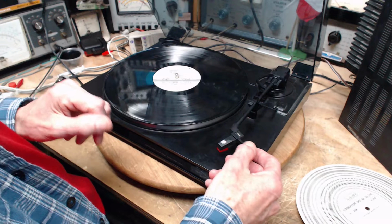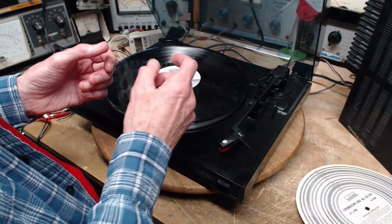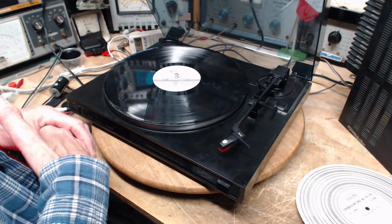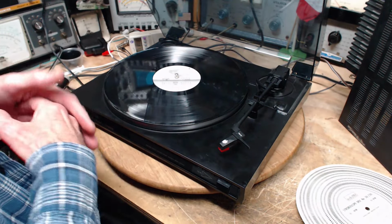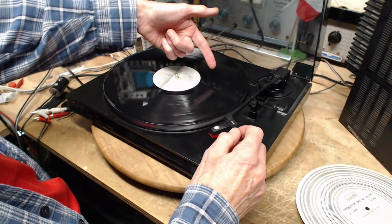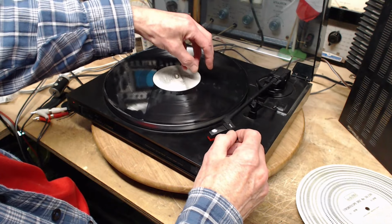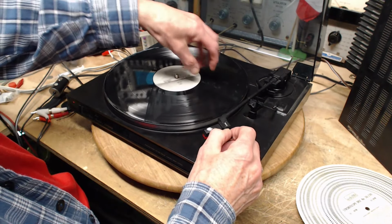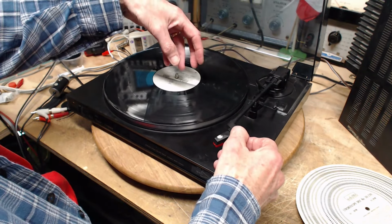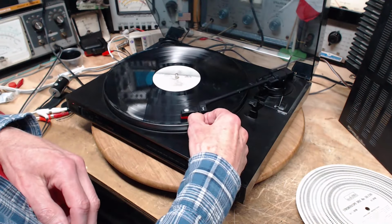And the weirdness is when it refuses to play a record. The option would be to go in and take that velocity sensor and disable it somehow so it cannot get stuck in the trigger position or something like that. The problem with that is that this tone arm is linked, as you know, underneath here to a pusher that pushes right on this piece. And if you were to, for instance, glue the piece down so it doesn't go into the automatic mode, then the record player becomes a manual record player from then on. It's half manual anyway, right? The only way the needle gets on the record is because you put it there, right?